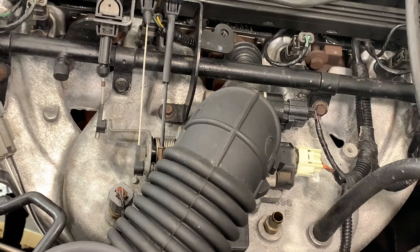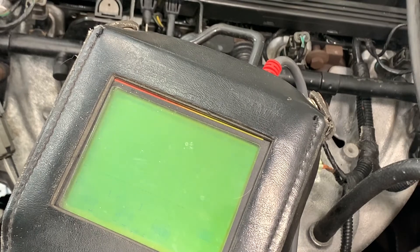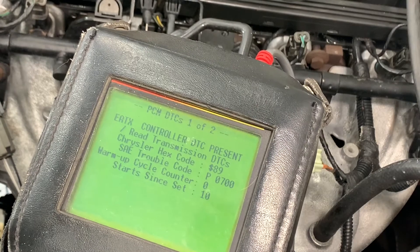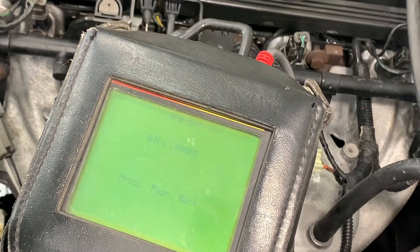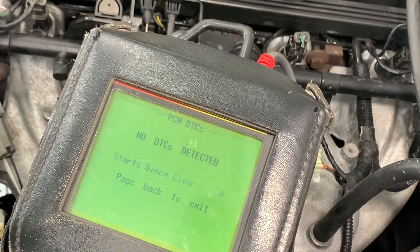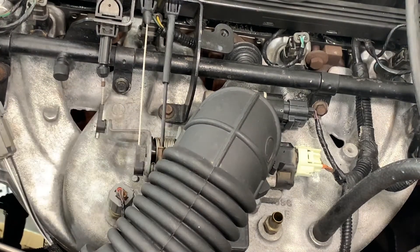That's the short of how to replace your throttle position sensor and troubleshoot it. Last step — I'll go ahead and clear out these codes. Unrelated code and throttle code P0123 — we'll erase it and reread. Now we have no DTCs because it is working correctly, whereas before it would come right back because it was just not reading correctly at all.